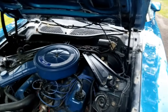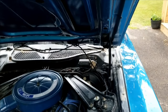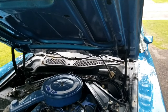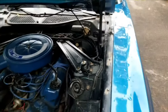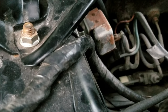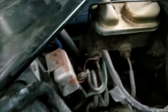Hey guys, it's been a couple days and the window has been working great. I just wanted to mention two things that may also affect your window not working. In this case the motor was still working and the gear was broken, but initially when I bought the car the power windows and power top stopped working. Always check your fuses first — that's under the driver's side. But two more places to look: this is the relay. It might just be for the top, but I've heard it's also for the windows because there's a lot of power draw for both.